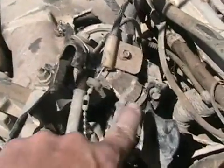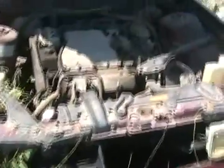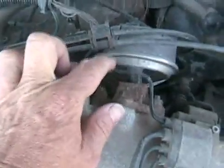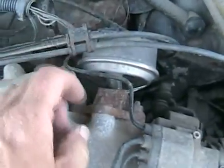That hole is attached to a pipe or duct to the intake manifold. In this model it has a pipe. That pipe runs to the exhaust manifold, usually someplace close to the head. And this Pontiac 2.8 does what I call the hybrid model — it has electric wires going to it for sensors, and it also has a vacuum hose going to it to actually operate it, so it uses a diaphragm too.